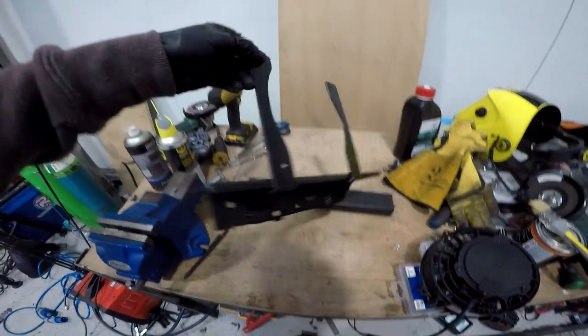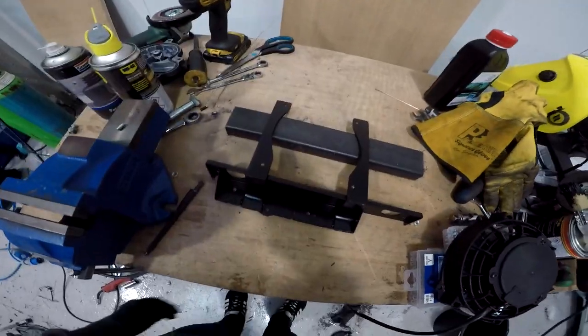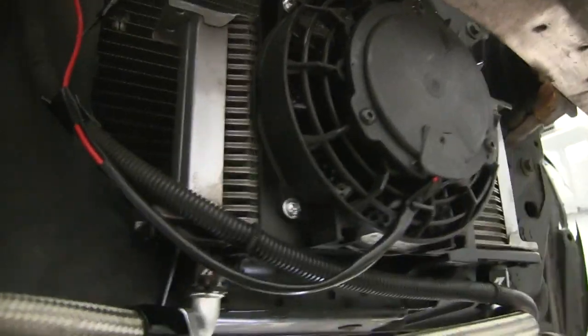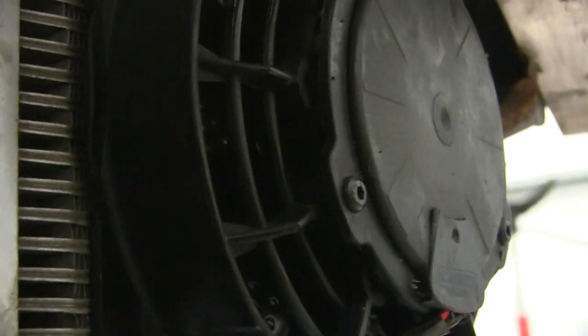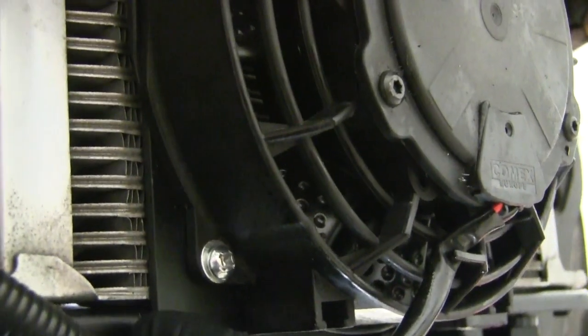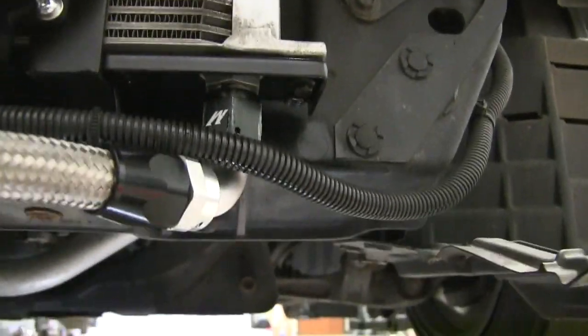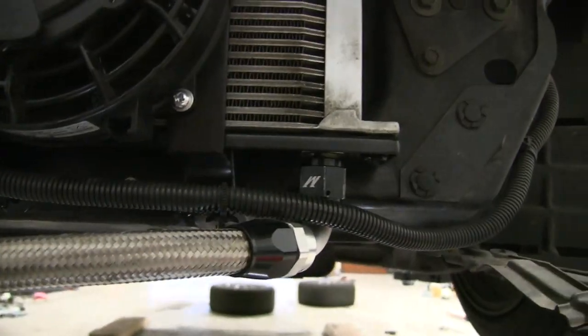The paint is all dry now and it looks presentable - I didn't go to town masking anything off, just sprayed the whole thing. It's on the car now. It was a bit of a nightmare to get the oil cooler back onto the plate because I've made the bracket very close to the oil cooler - at the bottom it's actually a little bit too close. I didn't appreciate that the oil cooler overhangs the original bracket slightly. I had to bodge it a bit to get it on but it is on. I'm just checking to make sure there's no leaks because these connectors can be a pain for leaking if you don't do them up super tight.